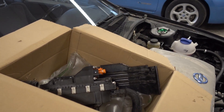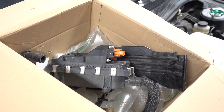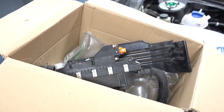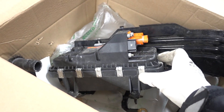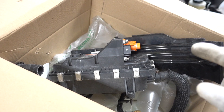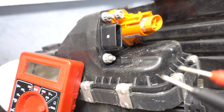The customer planned ahead and actually brought a known working PTC heater with the car. As soon as you have a problem with these on the early Leaf, checking the fuse is also a common failure point, but it's best to first replace this one and then reassess the situation — see if the vehicle started to work right away or if you need to look at some fuses also. So let's go through the process of replacing this.